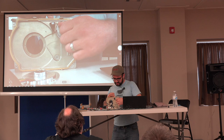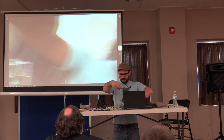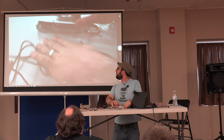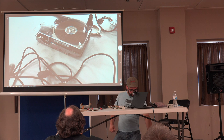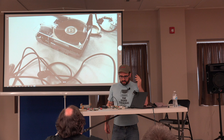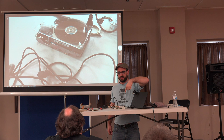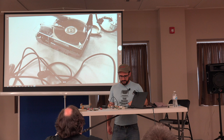And this drive, on the other hand, is not carefully made. This is a MiniScribe disk, and if you've ever had an old Macintosh, you might have heard one of these things groan to life. And you'll notice the stepper has this optical interrupter on it, and the thing has to spin around like twice to move the head all the way across the disk. So it ends up being very slow. I've got this set up to do a butterfly seek, so it should start here in a moment.